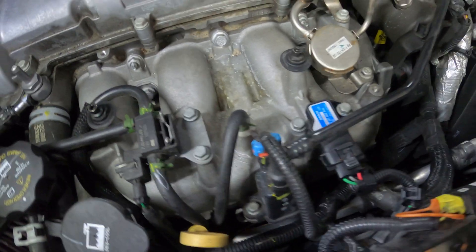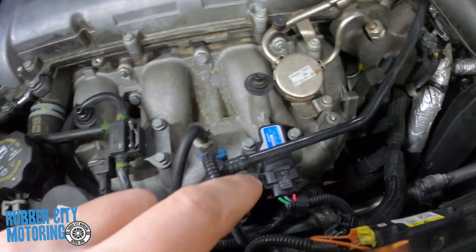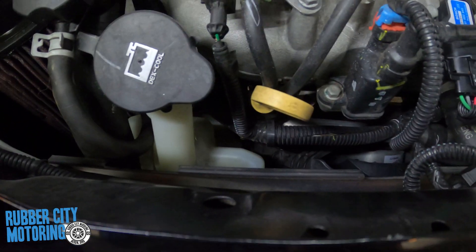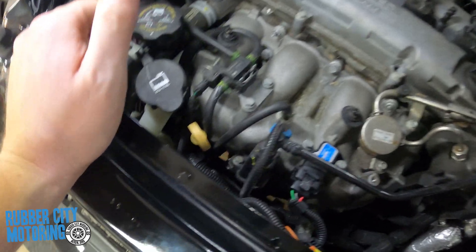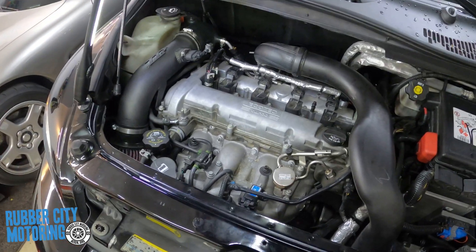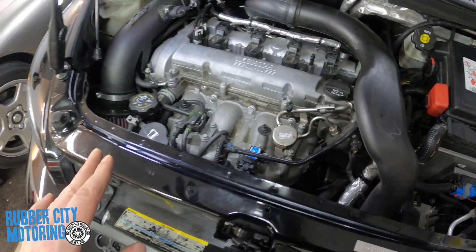That's going to do it for the ZZP — they call it the GM Stage One MAP sensors, they're just the Bosch units. Recapping: the top was super easy, the bottom not so much. Everybody claims you can get to it from the top, but you'd need a really skinny long arm. Some people move the overflow tank, some remove the bumper. If you're getting to that lower charge pipe, you'd be smart to pull the wheels, bumper, and all sorts of stuff.